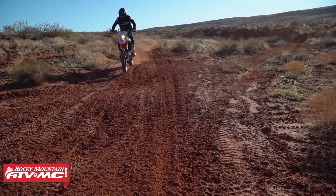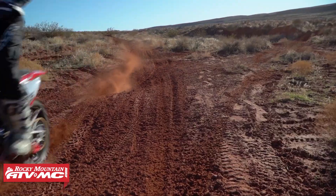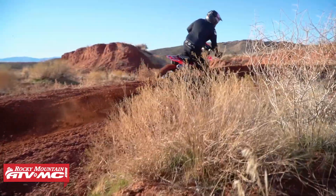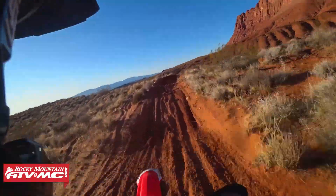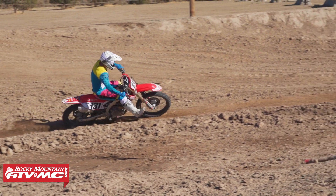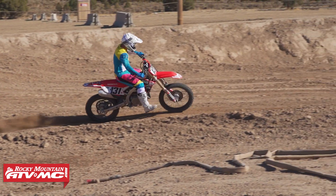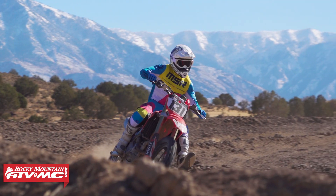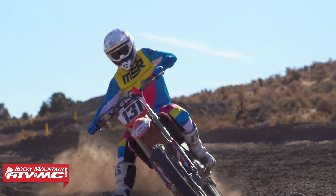Now, with this tool, it is a little spendy — it's in the $500 range — but the tool is cheaper than buying an exhaust system. If you have other friends with Honda fuel-injected dirt bikes, you guys can go in on it together to make it cheaper. The software can actually hold up to 30 different maps at a time, so you can create your own custom maps or just download a map, which is the easiest way. Send it to the ECU and be done with it — it only takes a couple seconds. You don't have to deal with jets like the old bikes.